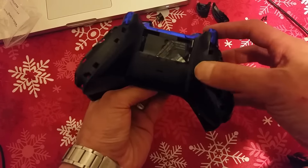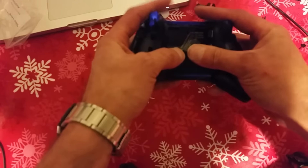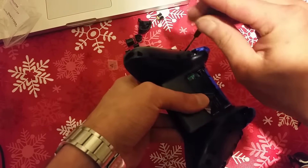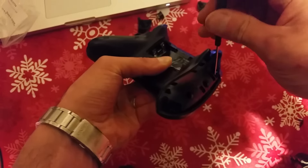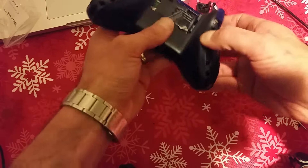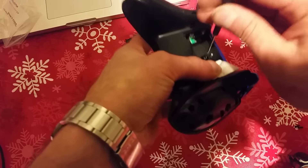Once you've screwed the back chip back in place from those screws we took out earlier, put your back cover on. Push on the right and left trigger buttons before you set that in there so they're sitting on the inside of the back cover and that way they work. Now go ahead and put the four screws back in place around the edges, and then the screw in the middle. Let's put that middle screw on the back of the controller. Once that's on, put the sticker with the serial number back in place, and get the two bottom screws on the bottom of the controller back in place as well.